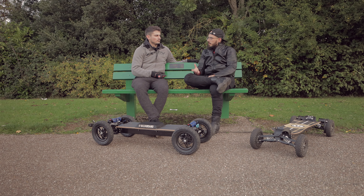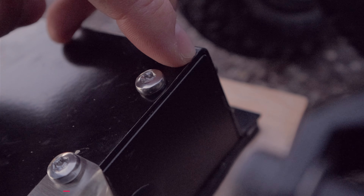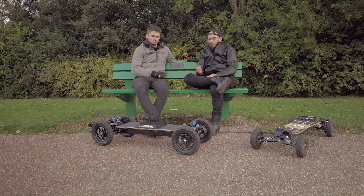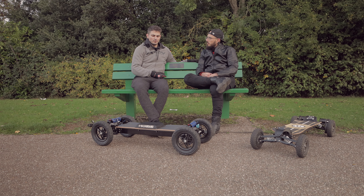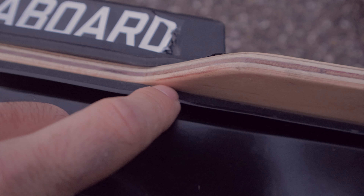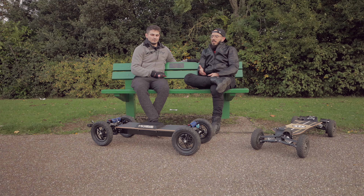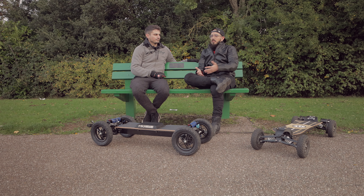Another thing I noticed — besides the board getting bent on that day — is how thin the metal is beneath it. It's ridiculous. I'll be putting it side by side with the Endeavour S so you can see the difference in thickness. When you were starting the screws, what happened? The chassis was bending. That shows how thin the metal really is. And if you think that on the other side you have batteries — if you hit some stones doing off-road you can damage them, and you essentially have a ticking bomb inside your house because damaging one of the cells could cause a fire.